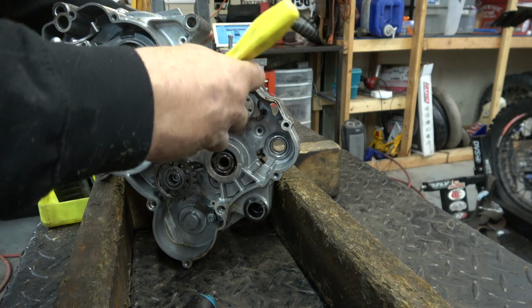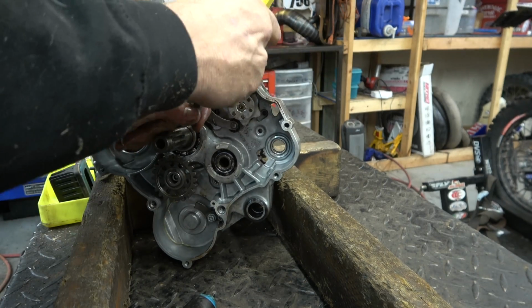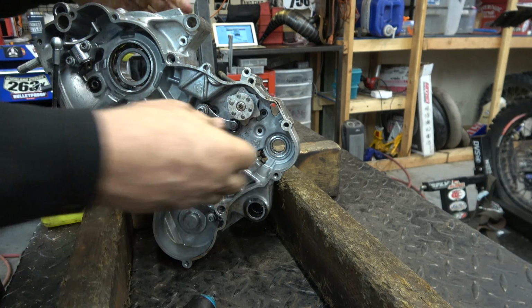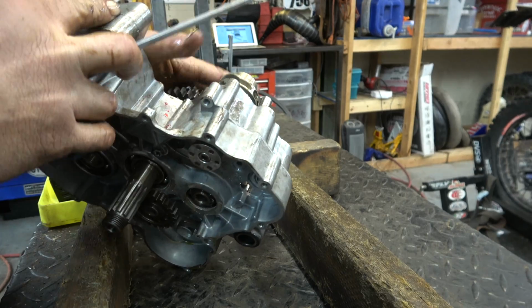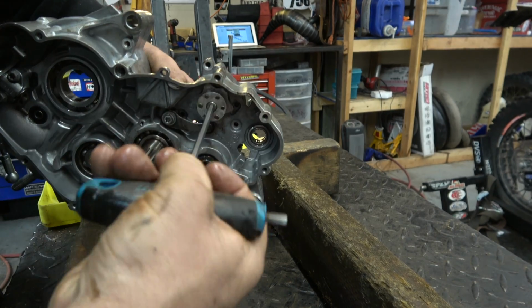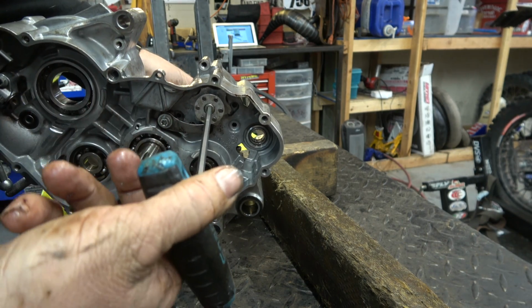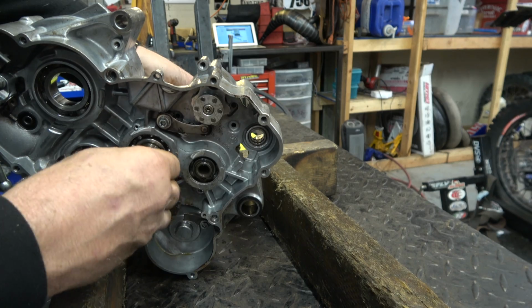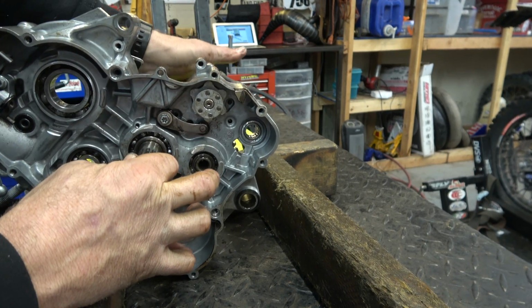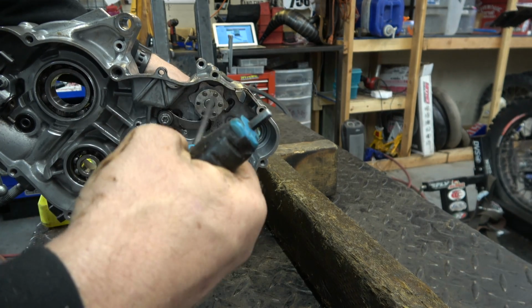So now it's hitting the detents. Come in nice and tight. And this thing's about 7 foot-pounds, so you don't need to go crazy, but we put a bunch of Loctite on it, so it should be good. Holding our hand on the back like this, keep everything in place. Get this rotated to where it's in neutral. And the thing about shifting is, as you're shifting, it's going to go a little bit. Sometimes it went all the way on that one, which is good. But sometimes it'll only go part way, like that. It's kind of hung up. So you've got to hold the counter shaft and the main shaft and twist them together, and you see how it clicked in. So now, looks like we're almost to neutral.